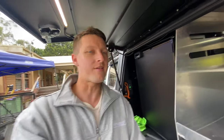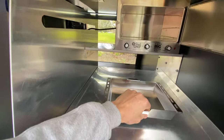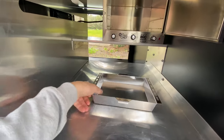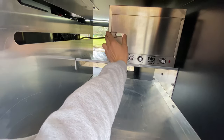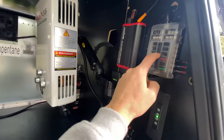The Big Bertha road oven is in. This thing is huge. Super simple install — it comes with this little tray here, plus also two wire rack trays as well, so you can get pies and stuff in. Huge amount of room. Swinging around to the other side, here comes our wire out through, and this will just plug straight into this Anderson plug here, then we'll fuse it with a 30 amp fuse. When both elements are on, it actually takes 21 amps, so we'll fuse it to 30, and we'll have no dramas there. Still waiting on those cable ties to make everything nice and tidy.